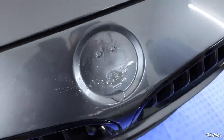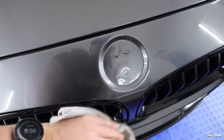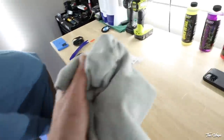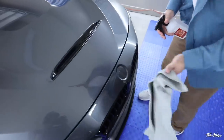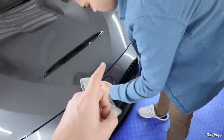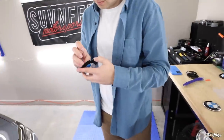On his car the tape came right up, which is ideal — this is a freshly painted bumper. You can see the little guide points right here, and that 3M just came right off because of how new it was, which makes our life extremely easy. After you get all the 3M off, hit it with some isopropyl and a rag just to make sure the contact surface is super clean. More than likely you guys are going to have a bunch of adhesive there — make sure you get it all off before you put on the new badge, it will not adhere as well if you don't. Nice and clean just like that — that's how you want it.